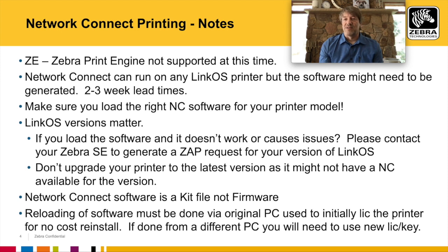Installing the wrong kit file can cause all kinds of problems. If the install starts loading and gets to two to three percent and then errors out, odds are you're loading the wrong kit file onto the wrong printer, or you're trying to install the kit file as firmware. It is not firmware — it is a kit file, even though you may hear it talked about as firmware.